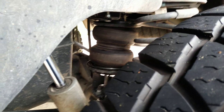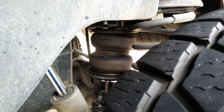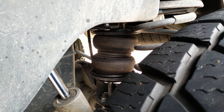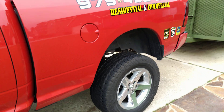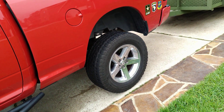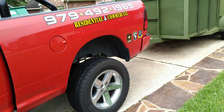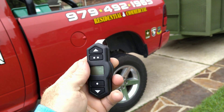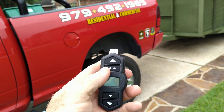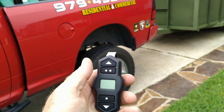So now my payload is 5,000 pounds. It does have a max of 100 PSI. On this controller, it's two preset settings — it's digital, it's wireless. You can preset either one that you want. I think the bottom one I have at 5 PSI, and the top I have at like 50.